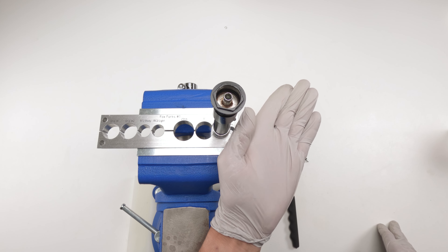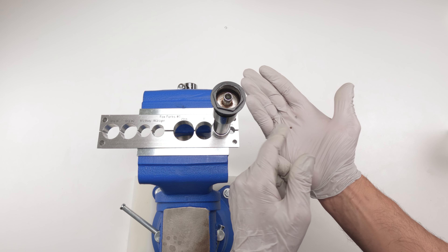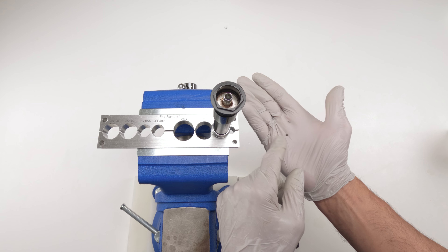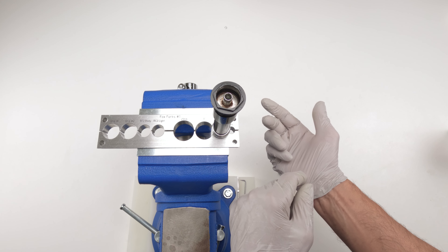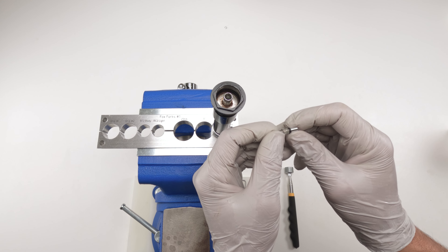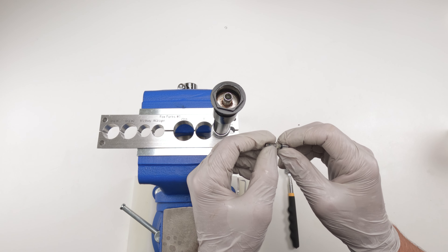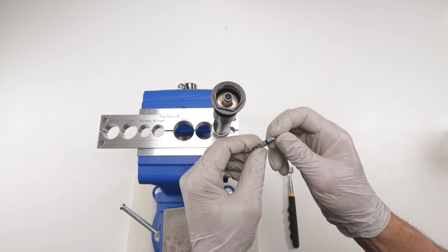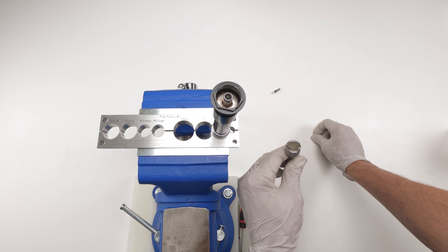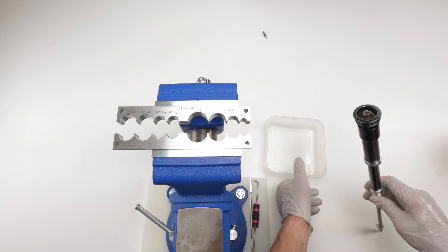I lucked out big time. There's our ball and there's the spring — they were literally on the carpet next to me, no more than about five inches from each other. I found them with a very powerful magnet within the first few minutes. So we've got a couple of problems here. One, there is some serious corrosion — which is the reason the low speed compression knob isn't working. Two, there's corrosion on the ball. You might have to replace all this stuff. Put your C-clip, ball, and spring on the magnet and put them in a safe spot. Do not lose these.